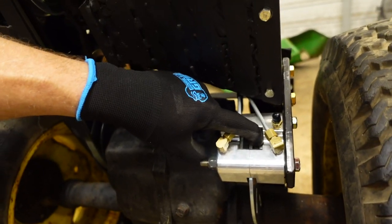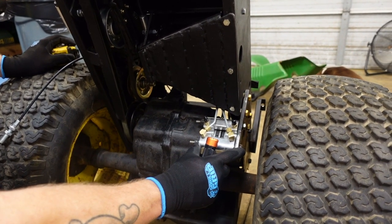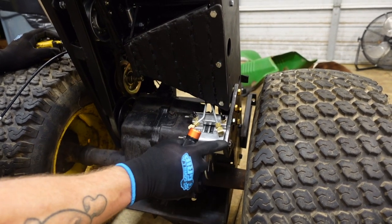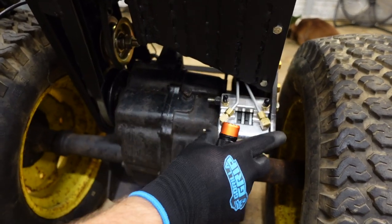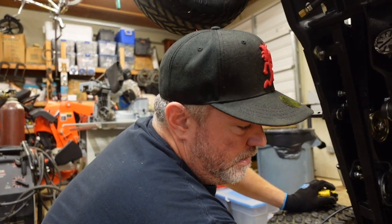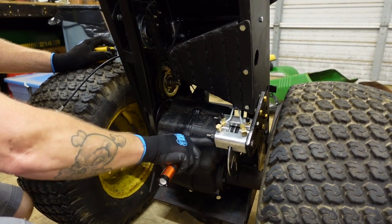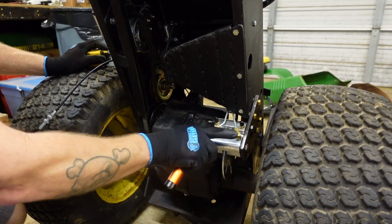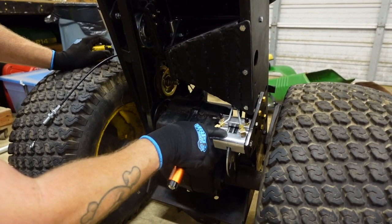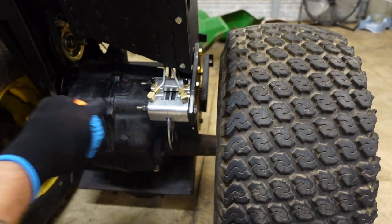One more thing worth mentioning — going back to the MCP brake caliper: the pad on the right-hand side, when I applied the brake it would bind up and not retract. The brake was getting pinched between the mount I made and the housing of the transmission, causing a binding action. I ended up taking the mount back off. There are also adjustment screws — Allen-head set screws — on these brake pads that let you set the distance from the rotor. I put a washer between the frame and the brake mount and it helped quite a bit.